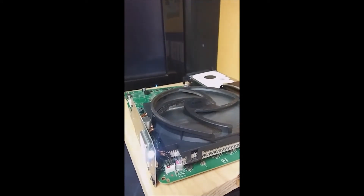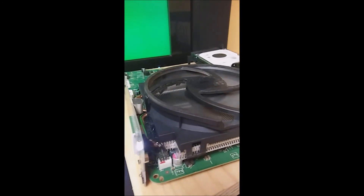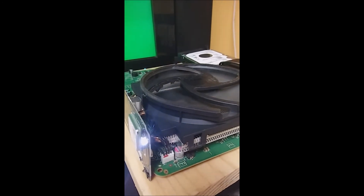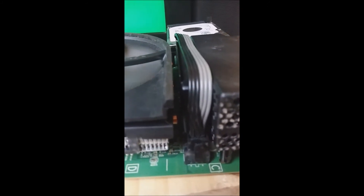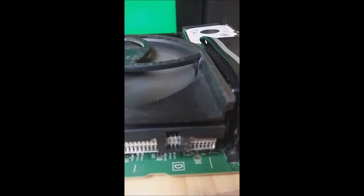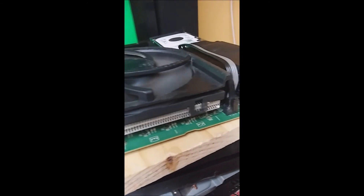The hard drive doesn't sound too healthy on this thing. But there you go — it was bad. The only thing that made me think this system was having other issues was the sound of the hard drive being a little loud, so maybe it's about to go. Sometimes when you wiggle ports around you actually see a picture — this one almost got the picture but then gives you the same kind of result. Usually that's the HDMI chip.